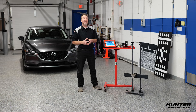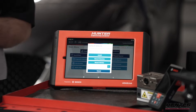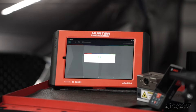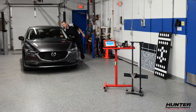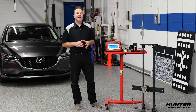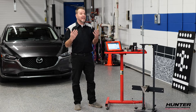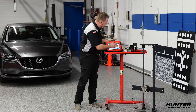You'll notice I don't have the DAS 3000 rack in front of me right now as it's not needed for this procedure. Everything I need is right here in front of us. First thing we're going to do is get into diagnostics. I'm already hooked up to our DLC with our VCI, so we're going to auto VIN this and cycle the ignition as well. This is where we get our steps in for all ADAS techs. Prior to any ADAS calibration, go ahead and do a pre-scan to make sure there are no DTCs related to the accident or any problems with the radar itself. I'm going to select all.